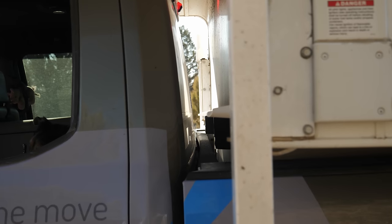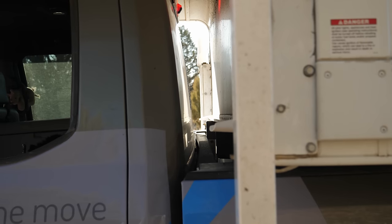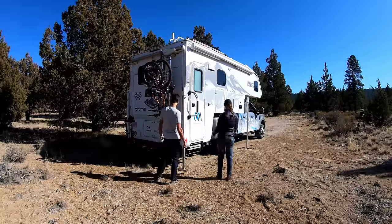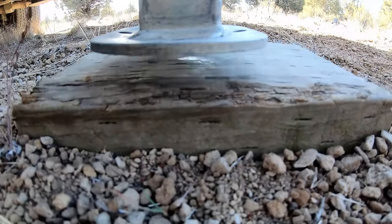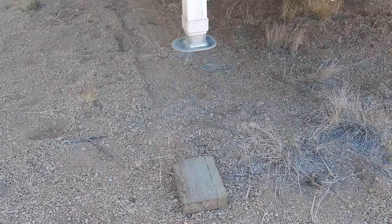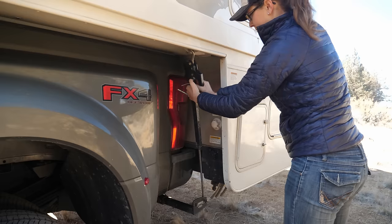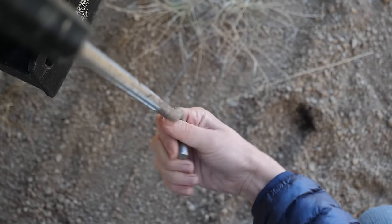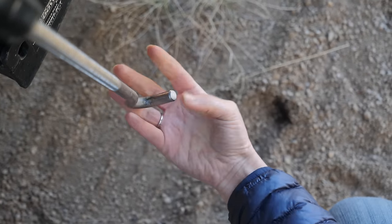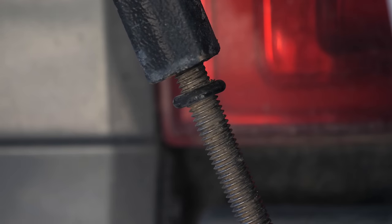Start lowering the camper a bit to see how it's going to rest, and at this point you may need to move the truck back or forward a few inches to get the perfect fit. Once lined up properly, lower the truck camper onto the bed of the truck and onto the truck suspension. Raise the jacks all the way up to help prevent dirt buildup and keep them cleaner. Once the jacks are all the way up, it's time to reattach the tie-downs. As the position of the truck camper may have shifted slightly, the tie-down tightness may need to be readjusted. With the fast gun tie-downs, screw them in and out to find proper tension — connect them and snap the turnbuckle down making sure the spring extends about a quarter inch.